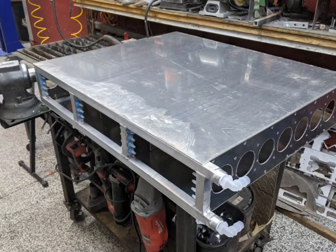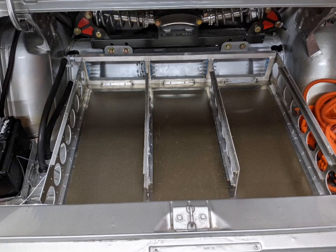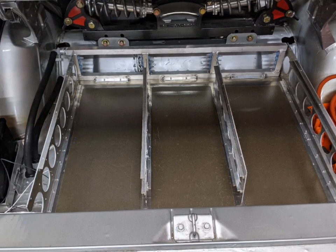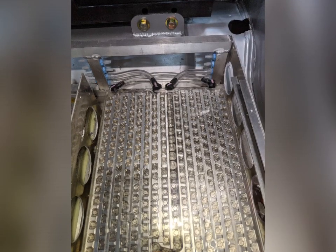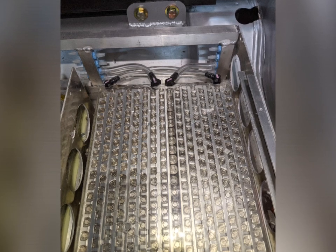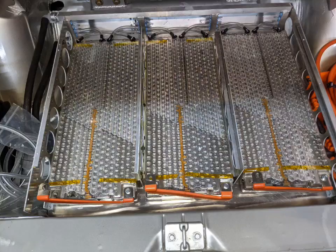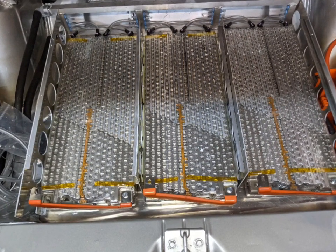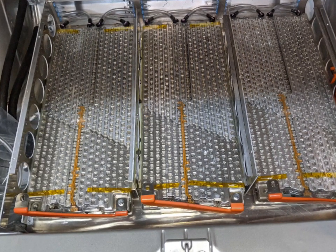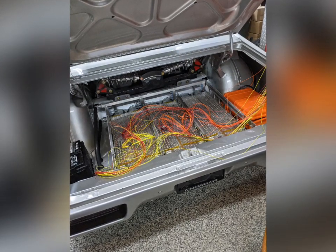The sides are open, and it became a nice structural box with angled shelves. I can place the modules on top of mica sheets, which are on the bottom as a liner — that's what Tesla uses in their battery pack. I'll separate each module with a mica sheet as an insulator. As they lay down in there you can see how the tubes fit — just like the box in the front but with shorter manifolds connected side to side. These fittings are an O-ring type that clip onto a little boss built into the battery module. I'm using bus bars from Stealth EV, with a negative terminal on the left to the positive on the right, so the left module is the most negative of the pack. It'll go up to the one above it, and then I use a jumper cable to the next stack.